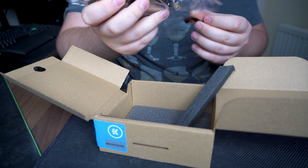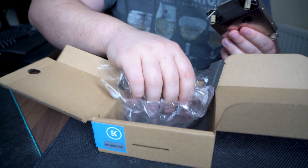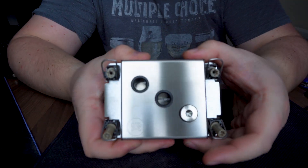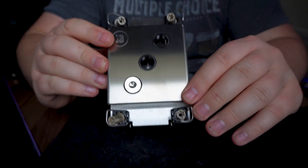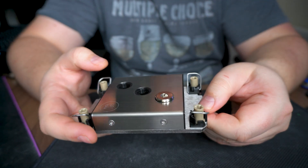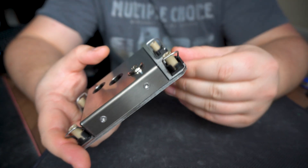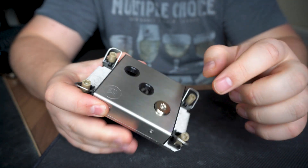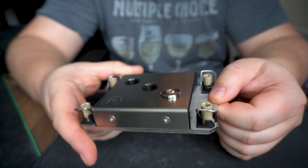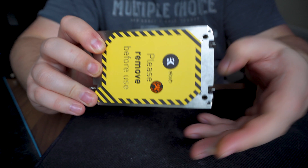Here's the monoblock, wrapped in a bag as usual. First thing I notice is it's not very thick and not very heavy. I've seen and installed bigger monoblocks than this one. The manufacturing finish is a bit raw — it's made of acetal and surrounded by what I think is a steel plate. The contact surface that sits against the CPU is quite large.